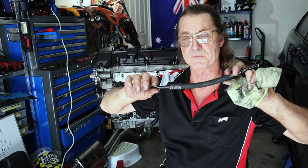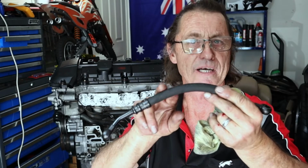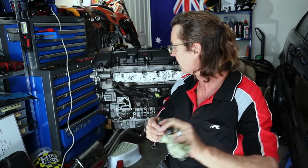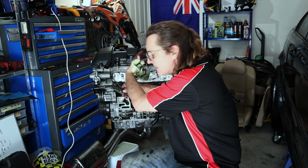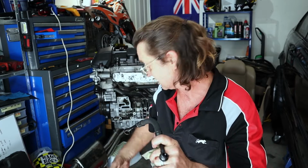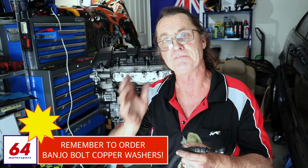I'll put a link in the description, but the reason is this is just a rubber hose, and it doesn't have just a regular rubber cover on it. It's got a cloth anti-abrasive cover on it. But because of its location near all these hot components, near the engine block and the water pump, that rubber will have a tendency to get hard and brittle. So if you're going to go to the expense and the hassle of ripping everything out to change that O-ring, replace this hose as well, particularly if you don't have any indication when it was changed.